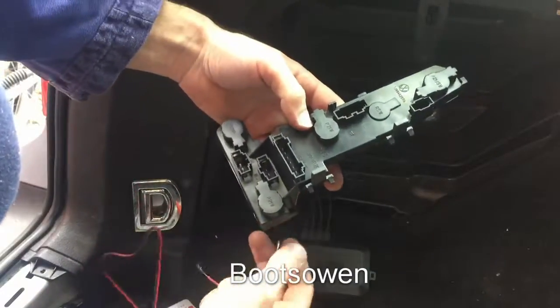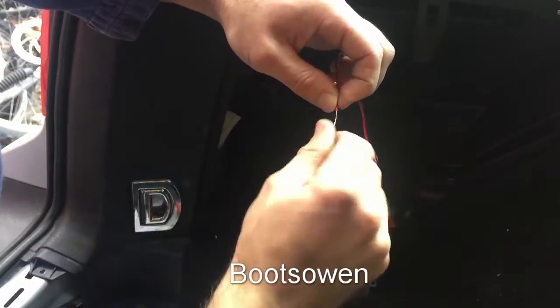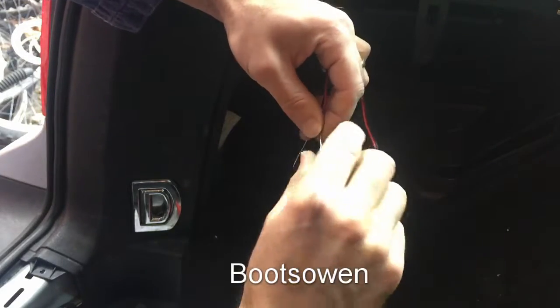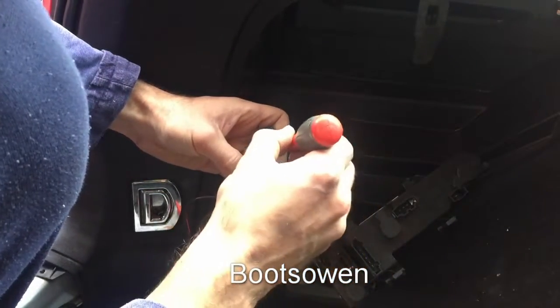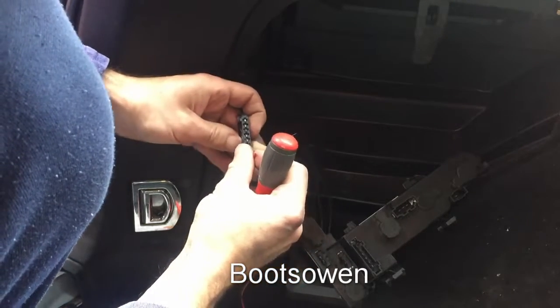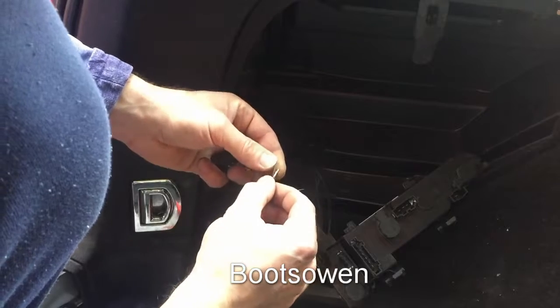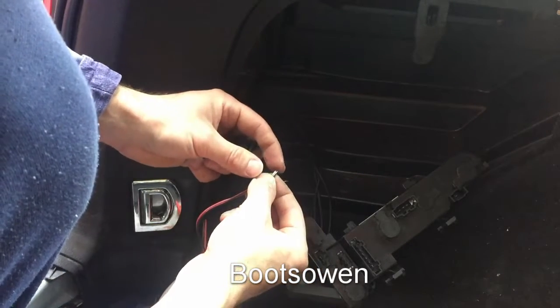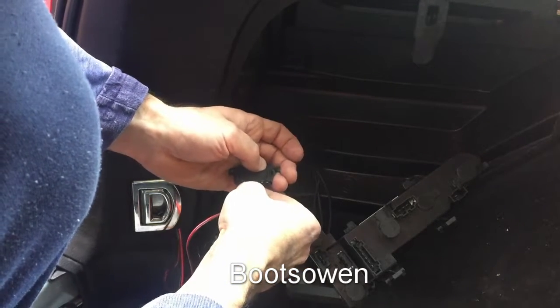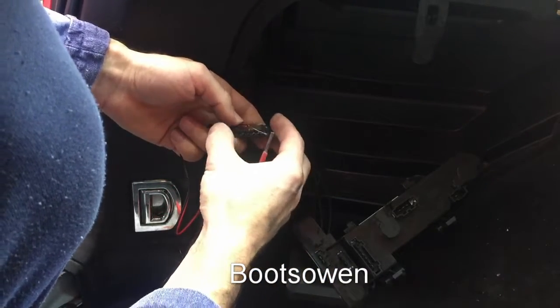So then the connector's in here, and if I remember how to do this now. Okay, there's my reversing light. Ground is the one furthest on the right in this case, because it's only a 5 connector. They're very fine cables. This runs off a very low current, I think. It's 12 volts, but it's a very low current. So what I'm going to do is just open this up with the screwdriver, if I can. Folding the tip of it over the screwdriver and then push it in with a wiggle. Hopefully I'll leave it there whenever it pulls out the screwdriver. Yeah, that would work.